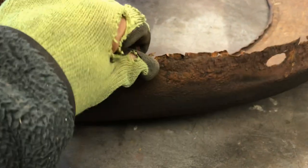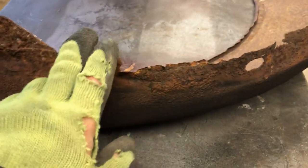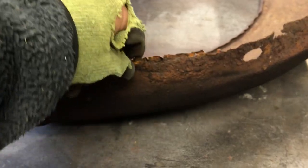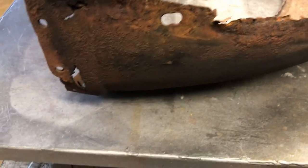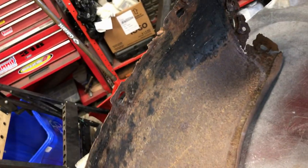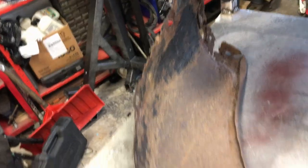This is a bit raggedy. I'll try and straighten that out and see what's underneath. All this is going to be hidden on the inside of the car anyway, so you won't see it. So as long as it's kind of rust free and not going to get any worse, I'll be okay with that. Down here, more holes to fill. But generally it's not bad, just a bit of surface rust. I'll probably have to clean all that up and then use the under sealer on the inside.